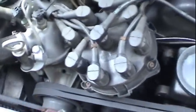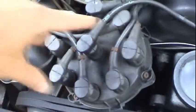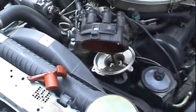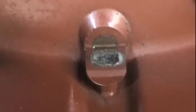And let me get a screwdriver and pop off the cap here and see what's going on inside here. Okay, got the cap and rotor pulled out along with this protective plate. And situation's not looking very good. Rotor button's worn pretty well, and we have pretty significant buildup of carbon deposits, metal transfer, those kinds of things on these electrodes.